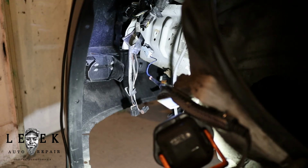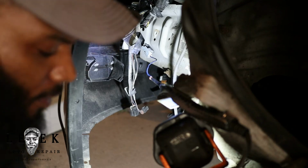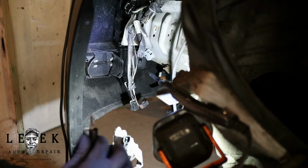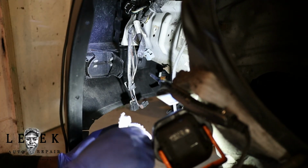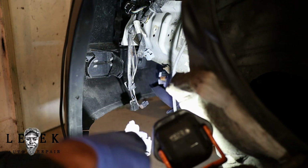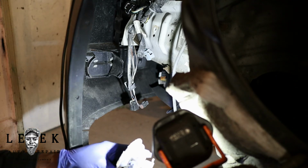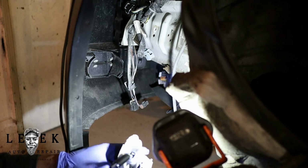All right. So we know the circuit is good. So that rules out this horn. So let's maybe see if I can power up this horn, my auxiliary ground from the test probe and power probe, I mean. So I have no continuity when I link the two circuits, the two pins together to create a circuit. Nothing. So basically there's an open. If I power it up, nothing was going to happen because there's no complete circuit. The power is not going to get sent anywhere.